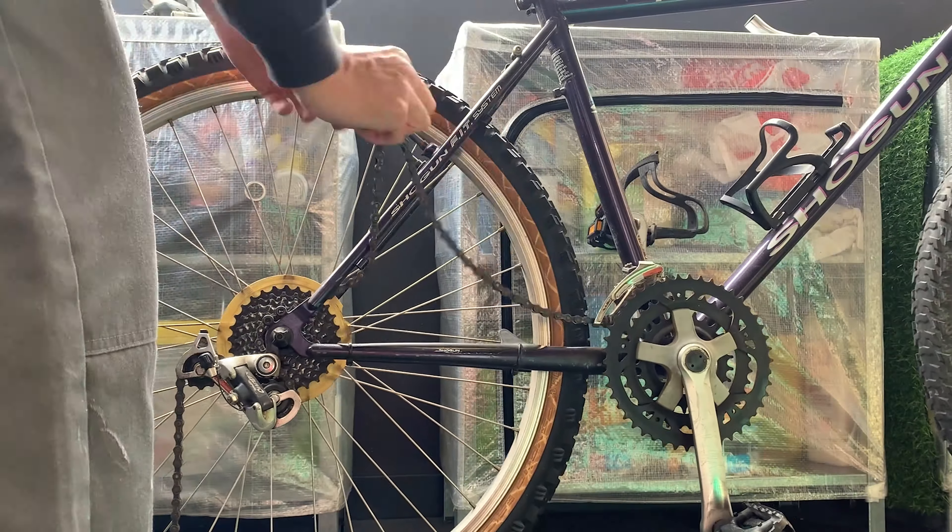Just taking the lock ring off — people usually over-tighten these way too much so I usually have a hard time, but this one was real easy, so I got lucky there. Taking the other side of the bottom bracket off, and the little Tioga adapter just using a screwdriver — no problems there. Taking off the rest of the stuff, the bottle cage and the little bolts. Here's what the bike kind of looks like once everything's pretty stripped — it looks pretty clean when the bike's like this.